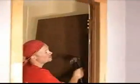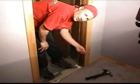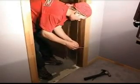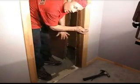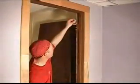And there we go. The pin's out. Now we just slide the door out, and there we have it. One removed door. One trick I like to do that I learned the hard way to make sure you don't lose these pins is just to put them back in at the frame, not on the door, because they can still fall out. Just put them back in the frame, one in the top, one in the bottom. You know they're there when you come back to put the door back on.